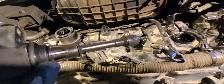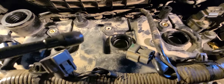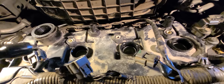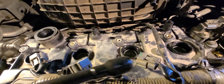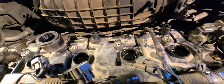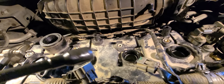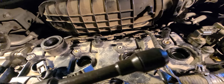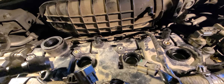Before pulling the plugs, I stuffed a bunch of paper towel in there and soaked up as much oil as I could, then blew it out with air, and pulled the plugs. In any case, if you get oil into your piston it will burn off — unless you have a whole lot, like if the tube was full and you dropped it all in there, that's a little too much, but it will smoke and burn off. Clean it as best as you can, and once you get the plug out, you can turn the vehicle over and it'll push out as much oil as possible — without trying to start it, but without the coil packs it won't start up anyway.